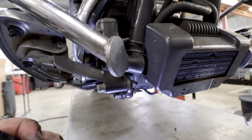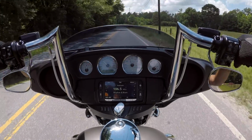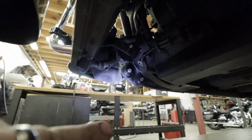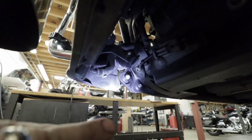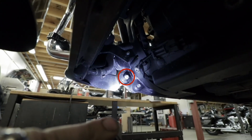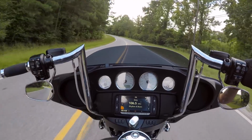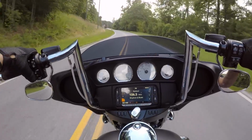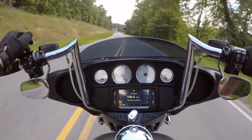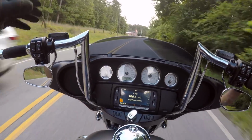Simple things like, in the '14 and later models, the motor mount bracket that is attached to the frame has a threaded hole in it, so you don't even have a nut on the back mount. Now you just roll up with a 5/16 Allen and you're zoop zoop done, and the footboard is off. Those simple little things like that are, well, they're cool.